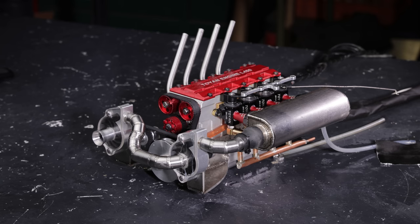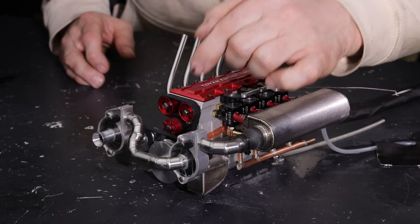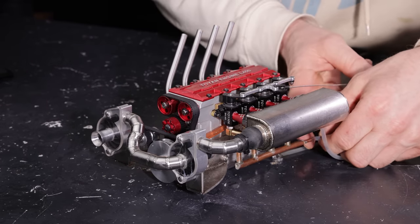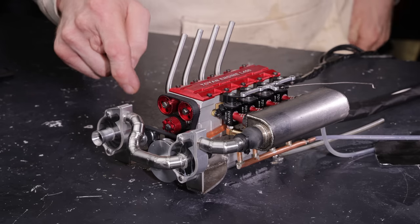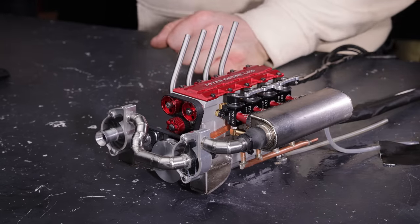All right, here we go. I got my pulley all fixed up. My intake tube pressed back into the supercharger. I made some adjustments there so it'll hold the pressure and it won't come out. And I added a little throttle extension because I don't really feel safe having my fingers right next to the engine just in case something happens. Like this happened, maybe something's gonna happen back here. All right, let me get it started. Hopefully, third time's a charm.